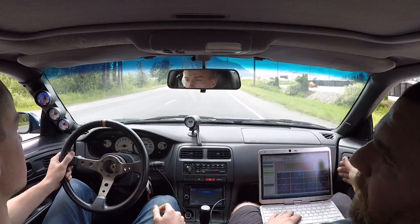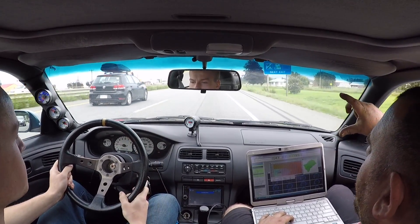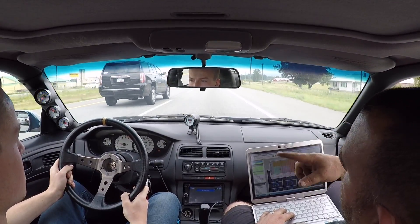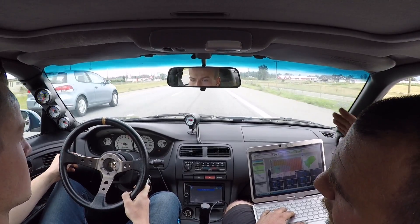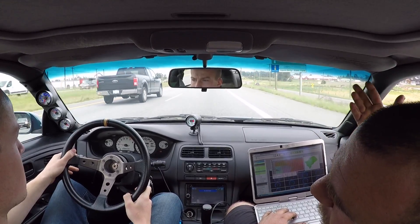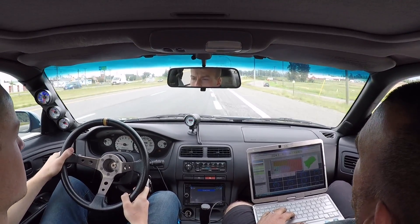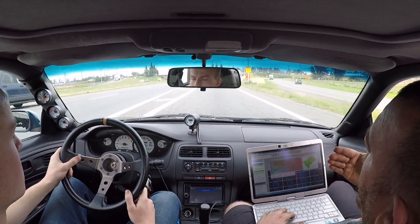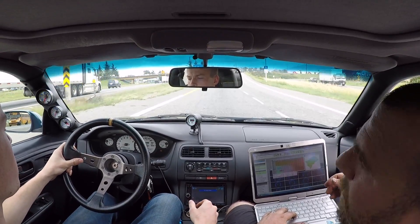You've warmed your rotor. It's a little bit richer than my gauge. On your gauge, I have you tuned for the most part in between about 10 and 10.5, 10.6 AFR. So keep an eye on that when you're wide open. If it were to go into a high 12, that would be a bit too lean. 11s is probably just fine, but you can kind of keep an eye on that.